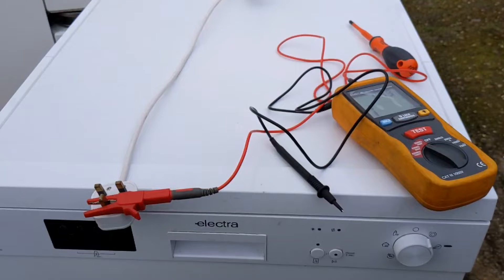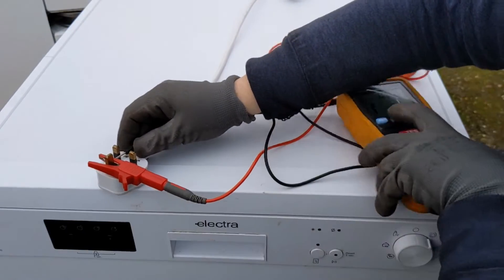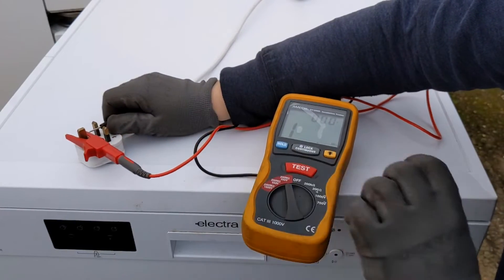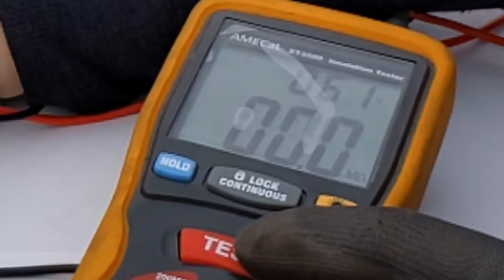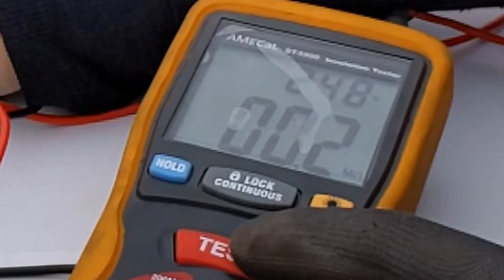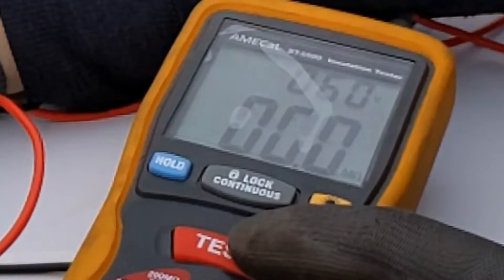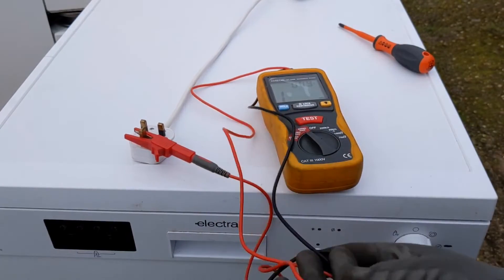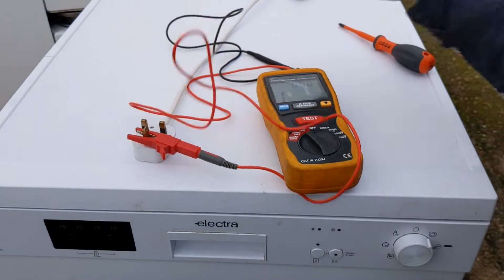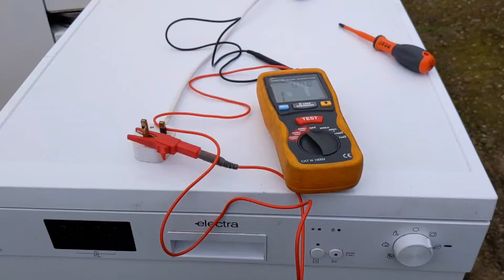So that's an interesting one isn't it? We've definitely got an issue. I'll just double check — yes, we're definitely getting zero, dropping out to 61 volts on one, that one's doing 250 volts. So I'd say the issue is on the line. I've actually found the fault already.